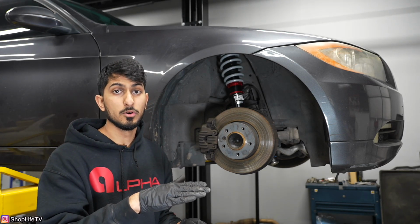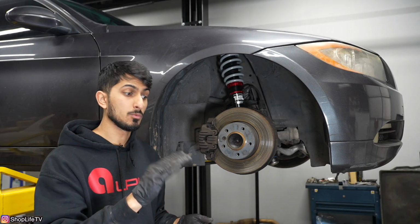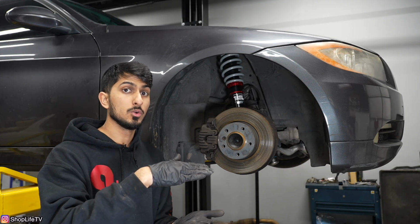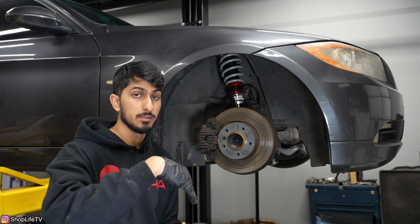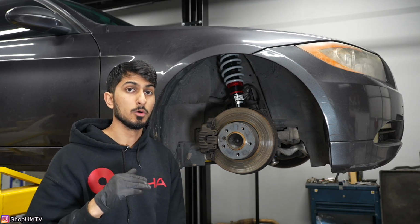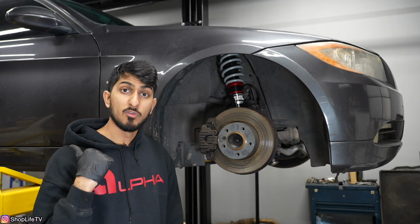You don't want to load up the bushings at full droop, because then when you're at ride height, those bushings are already super loaded, and then whenever you compress the suspension even more, it's going to load it even more, causing it to tear. Now, I've got a whole separate video that goes over that whole concept. It'll be linked down below in the description. Let's move on to the rear.